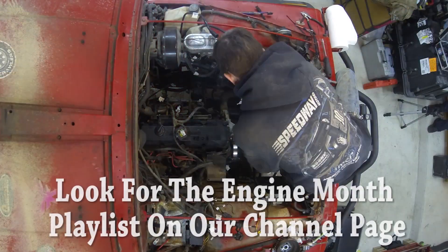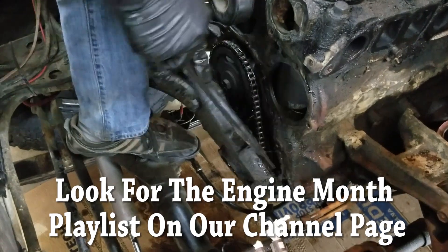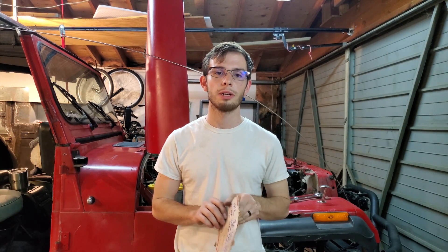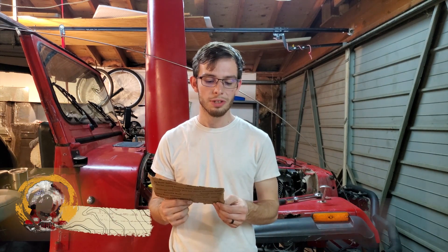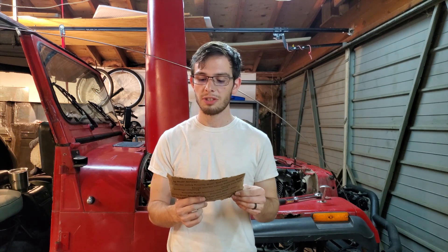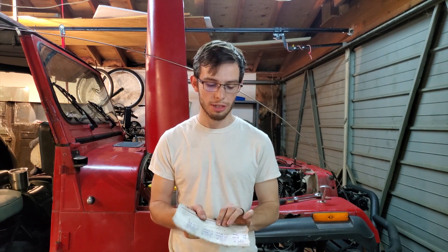This isn't really part of this video, but I want to show you this comparison. I have some other videos on this channel of me removing the engine of my Jeep and replacing it with a new remanufactured engine, and the reason I did that was because of compression — I had worn that engine out due to really poor maintenance. I have the compression from that engine written down here for comparison: cylinder one was at 70 PSI, cylinder two at 55 PSI, cylinder three 70, and cylinder four 65. On average that engine had about half the compression of this engine, and that's why I replaced it.